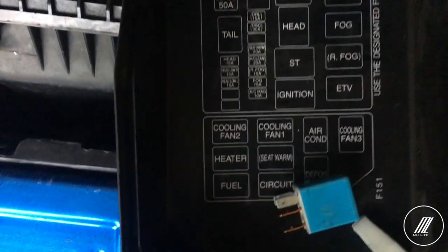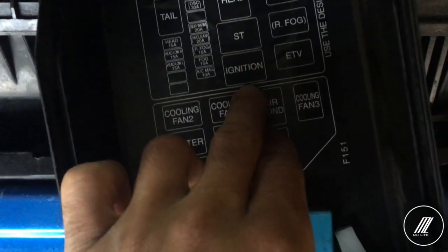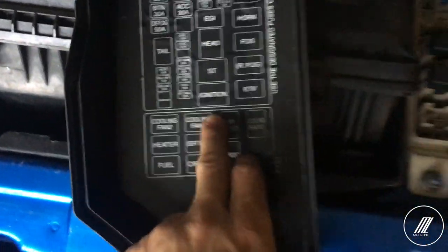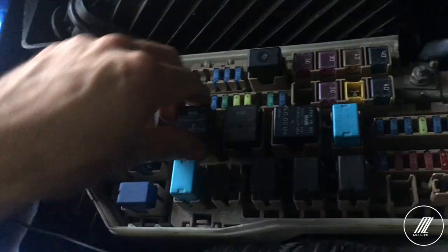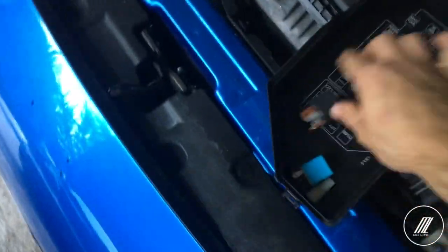Let's go to the fuses and take it from there. The fuse box is here. We're going to look at the box and follow the fuses. I disconnected the fuel already. For the spark, I think the ignition fuse is this one — I'm going to take that one out, hoping it's the coil ignition and not the key ignition. These square fuses, the big ones, are slightly hard to take out — wiggle it and put some force into it and it should eventually come up. Right now I've taken out the fuel and the ignition.